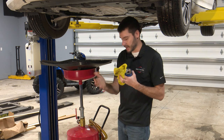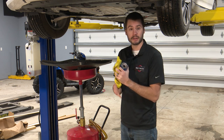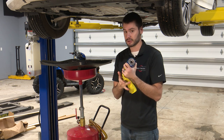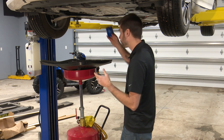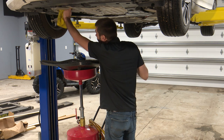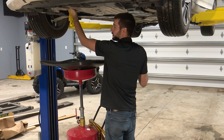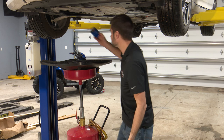I see a lot of people who are still filling oil filters before they go on the car. If you want to do that, go for it. I actually looked in the owner's manual here to see what Honda actually recommends, and it does not mention at all about filling the filter. We don't fill the filter — I don't think on really any cars anymore these days. Our oil filters are pretty small, and oil pressure is built up really quickly in the engine. So it's not something we really do, but if you like to fill the oil filter first, go for it.